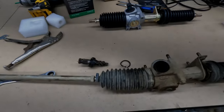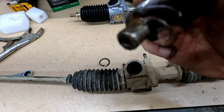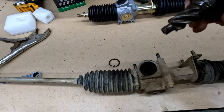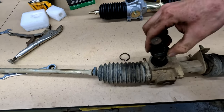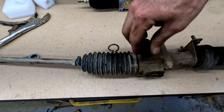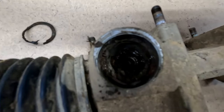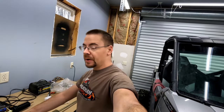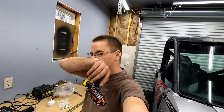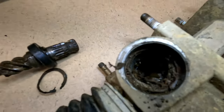Guys, here's what we got. I don't know if it's actually damaged or not — I mean there's damage and wear and tear now. What happened is this upper seal actually popped loose, and so this was just spinning and grinding in there. I don't know if there'd be a way to rebuild that or not. There's a ton of mud and gunk in there. The owner did admit that he had been noticing something funny in the steering for a long time; he was just ignoring it. But you can see in there — she's not too pretty anymore.